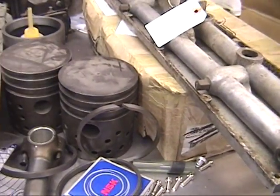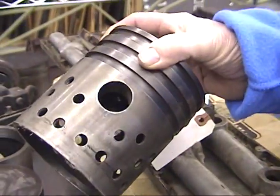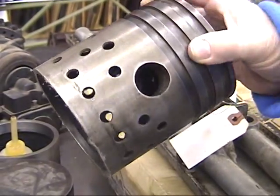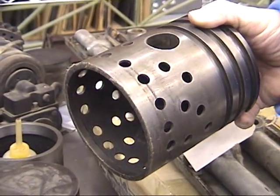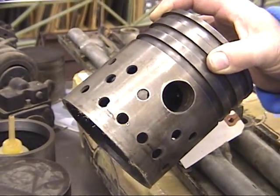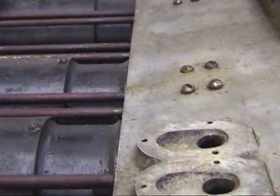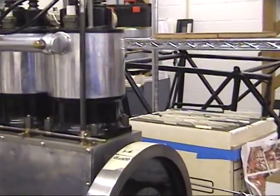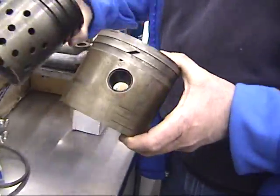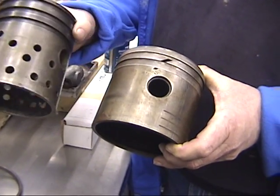These are actually out of engine 43, which are unique — they've been drilled for weight reduction. In order to make engine 43 run, the pistons have been duplicated with fresh iron castings, copying the whole pattern to duplicate what's inside number 43. Here's a piston out of the six and one out of the four — the four on the left and the six on the right.